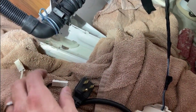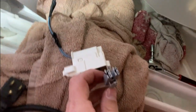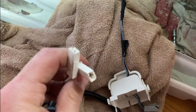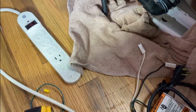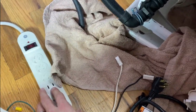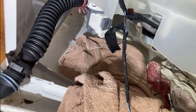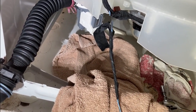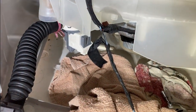What I was able to do is I took the pump out and plugged these clips into the pump down on the bottom. There are two clips — here's the actual factory clip that gets plugged in. I already had this setup, got lucky that I had kept this. I just plugged it into the pump, plugged it into the wall, and into a little outlet strip so I could turn it on and off. That worked with the pump out of the washing machine. So I reinstalled it and tried to run it again — it wouldn't work. I then put water in the tub and actually ran the pump under load, and it pumped the water out just fine.